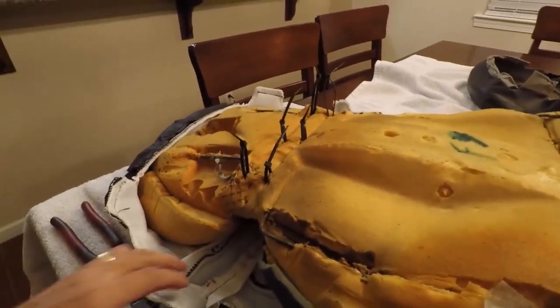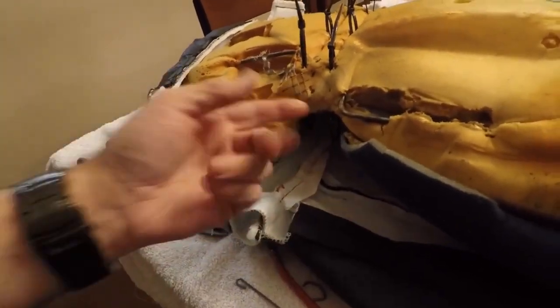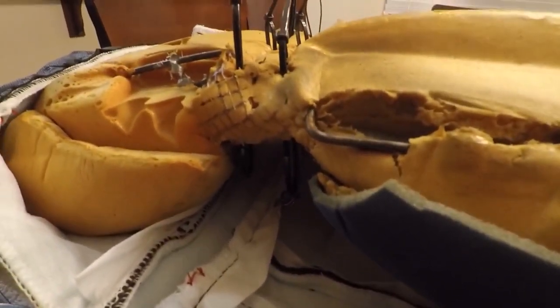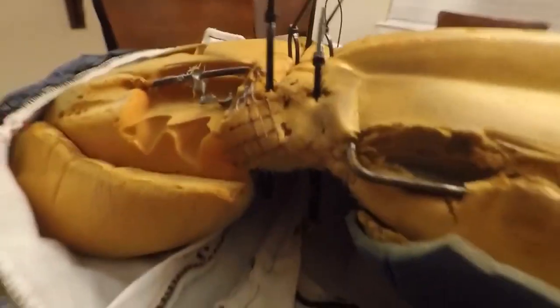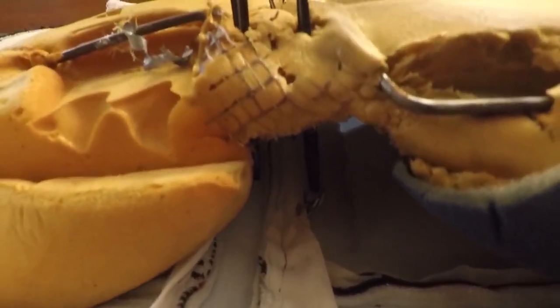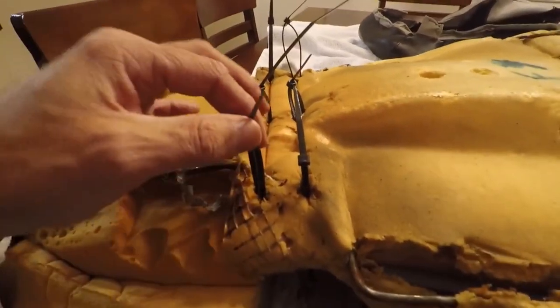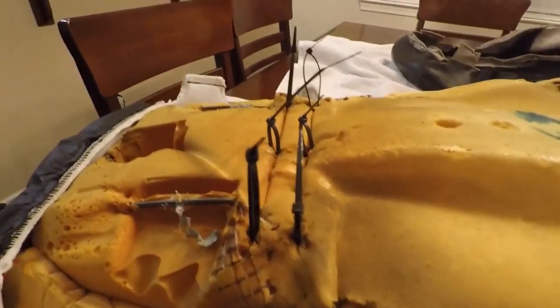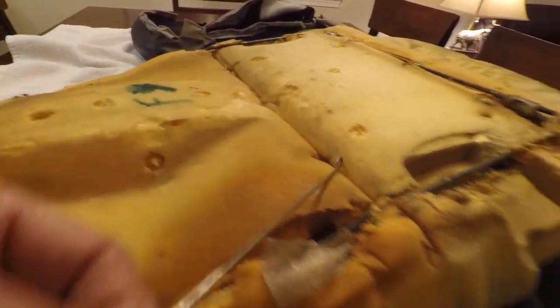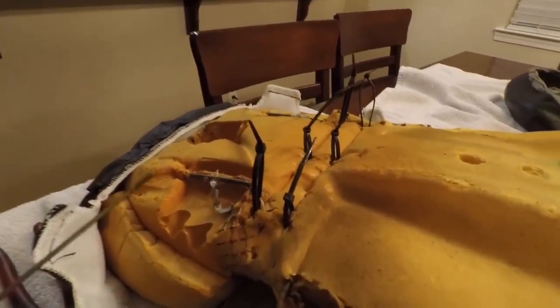I ran into a little bit of a problem. When I was trying to put these wire hooks back up through the foam, there's only a small channel right there that you can work from, and it's very, very tight. What I figured out was to take a zip tie and hook it through the hog ring — I hooked it through the ring and looped them all through, so you can see they all came up through here like this. Now I can pull these up one at a time and transfer the hook through them to lock them in place. Instead of beating yourself up, this is the way you'll be able to get it done without having to fight it.